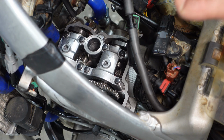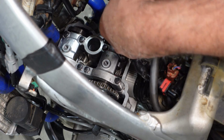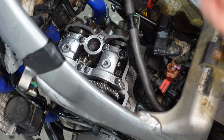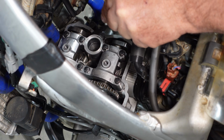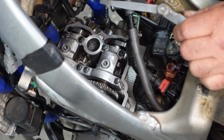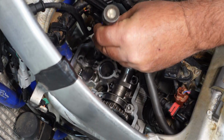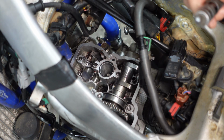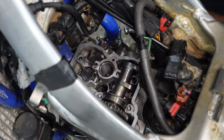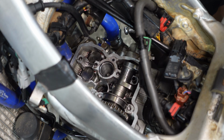And then we can just put our cams together at that point. We'll go 25 here, a quarter millimeter. 25 still goes through. And 28 is really dragging. So if we go one size thicker, that'll put us right at 0.22, and that'll be in spec. All right, throw a 2.95 in there. Get our cam chain back on and our timing set up properly now. We should be able to bolt this together, and our valve shimming is done.